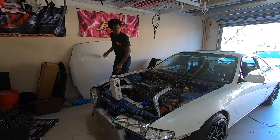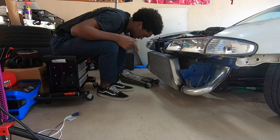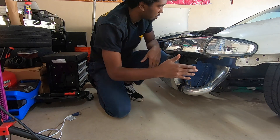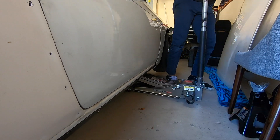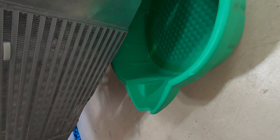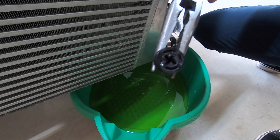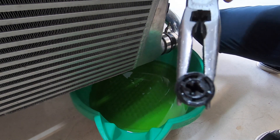The hood is off — it looks kind of cool. I've got to figure out what side the petcock is on and then I'm going to jack up on that side so the water flows towards that end. On my radiator the drain is on the right side, so I'm going to jack up the left side. I pulled out the plug and you can see it's plastic, which — I don't know what's up with that — but I need to replace it, so I'm probably going to order that tonight.